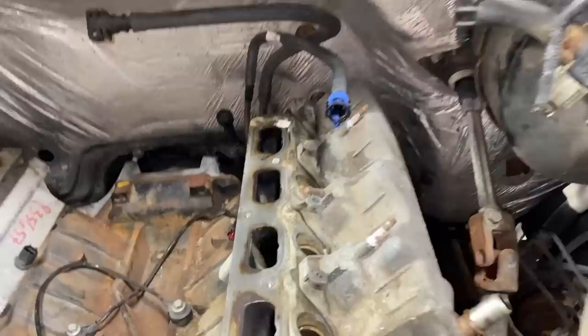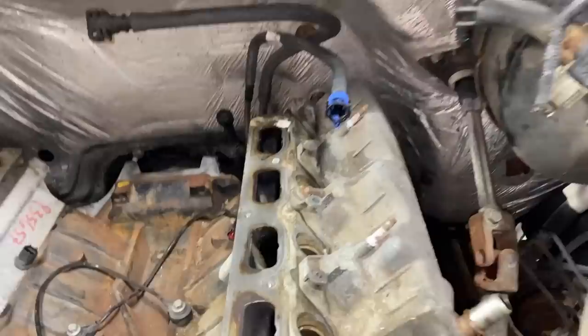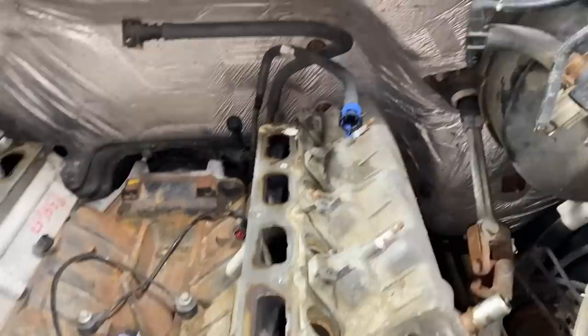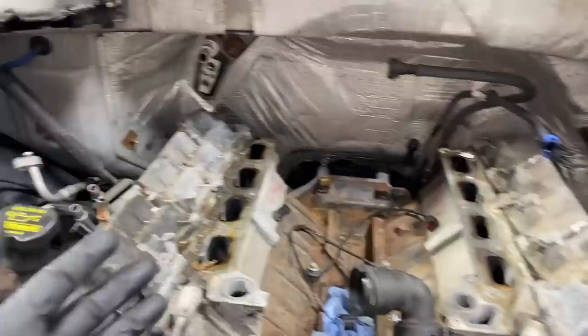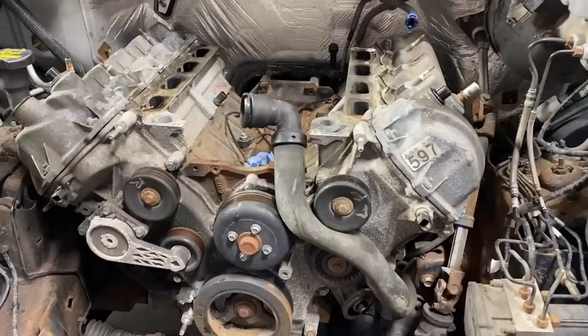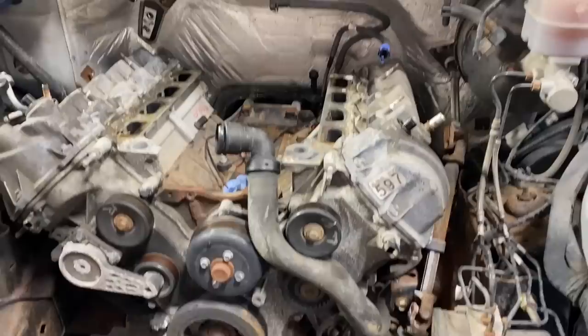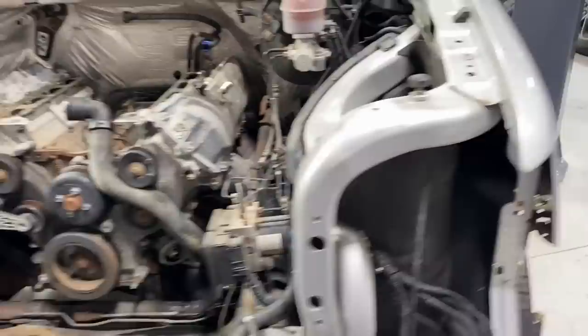When you have a plastic intake melt like that, it means hot exhaust gases or combustion gases - the actual fire from the combustion process - are making their way back up into the intake. The intake should only flow air, it should never get hot exhaust gases from the combustion chamber back up through there. It's only affecting number six, not any of the other cylinders, so it's definitely a valving issue - intake valve not sealing right and combustion gases coming back up and melting the intake. I said we need to pull the heads, send them to the machine shop, do a valve job - probably three grand or more. He said nope, put an engine in it.